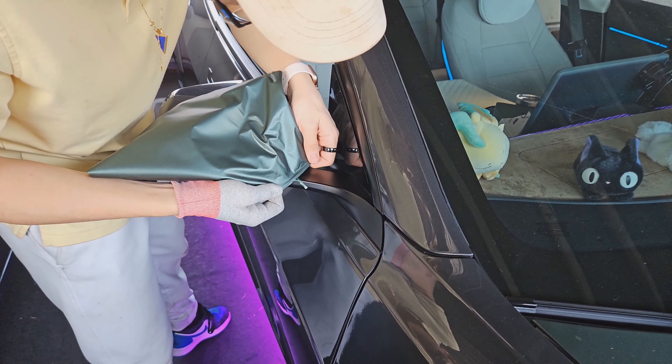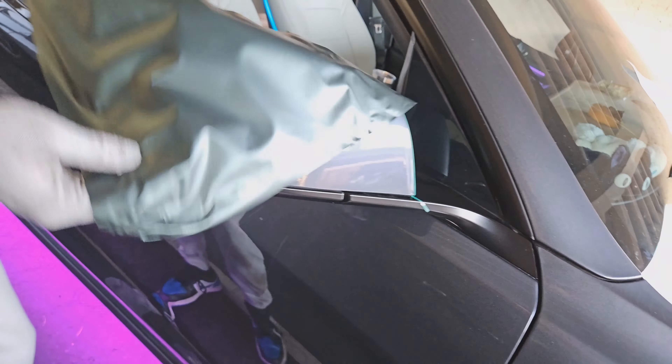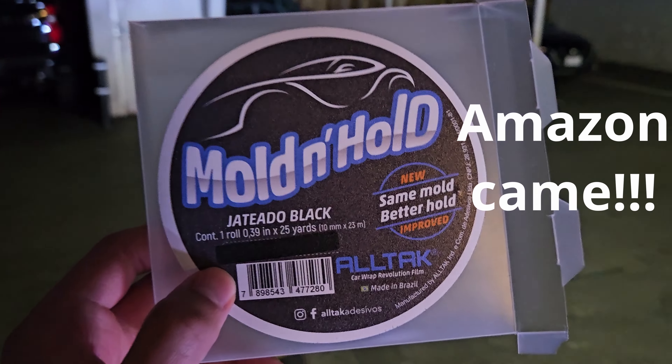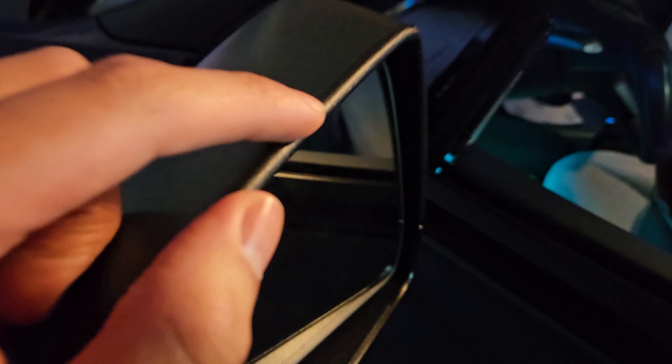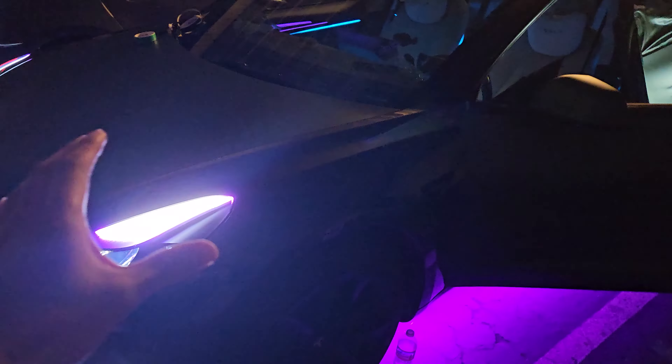It's time to finish the mirror cap that we started — they finished it before I even started filming. Basically you're just going to wrap a piece of vinyl to this side, pull it, and shape it. We have excess on the far side, this side, and down here — we're going to cut a bunch of the excess away, which makes it easier to be more precise and fold it over the mirror caps. We have another one of the floss tapes up in there — boom, oh that is nice! Then you just pull out that tape and press down the wrap. The floss tape is going to go along here and down the back, laying it flat, squeezing it down. The mirrors are pretty forgiving. Once we have it around on this side, we'll use that floss tape to make a nice clean cut, then fold down the edges on the side and on the top.